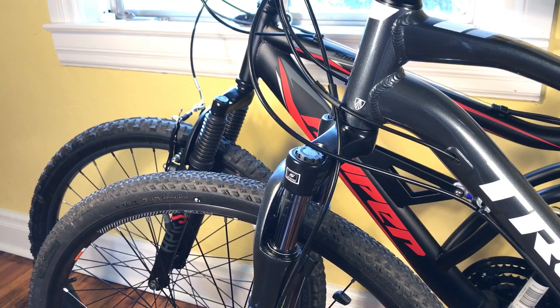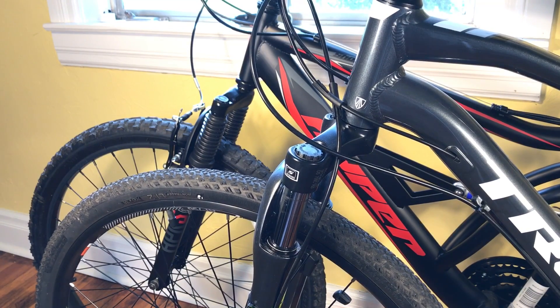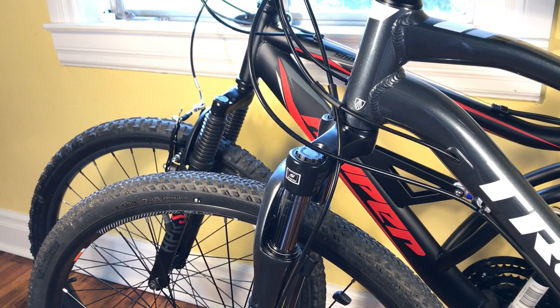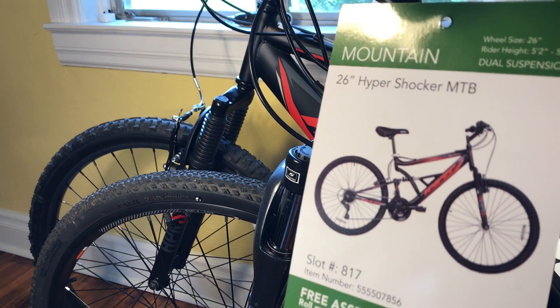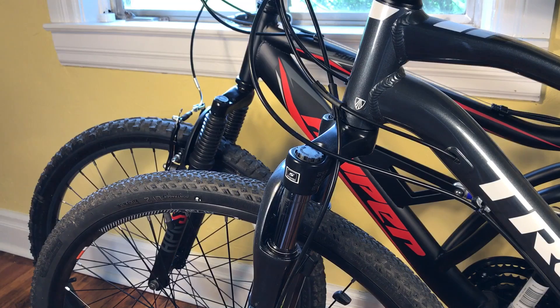It's a well-engineered, pricey compared to a Walmart bike bicycle. But just think about this — a hybrid at 63 millimeters, which you'd never see on any kind of a true mountain bike, and then something that is marketed as a mountain bike, a dual suspension mountain bike, that has 12.7 millimeters. And not just 12.7 millimeters — there's very little resistance to bottom that fork out. I can do it with my left hand just lightly pressing on the bike. We took this to a trail and it literally was beating itself to death. You'll see that in the video. Noises, things started happening.